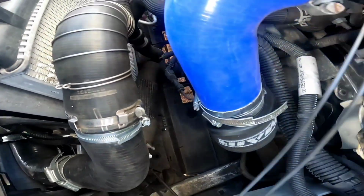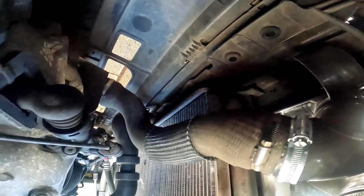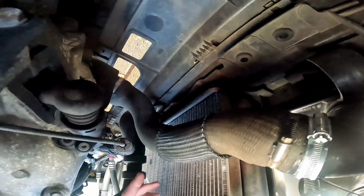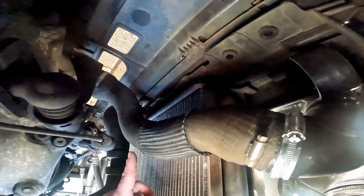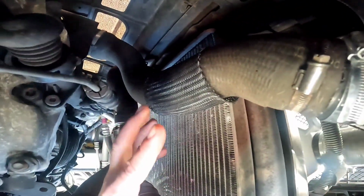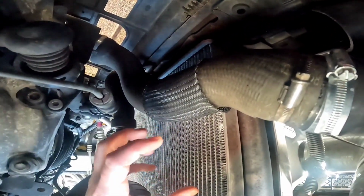Now, what you would also want to do, which I put in there as optional, as you can see, this pipe is under a bit of stretch. What you would ideally want to do in the real world to resolve this intercooler setup properly is to put a 90 bend here, a coupler, and then a 120 bend into here, and that would remove this stock pipe, allowing for better airflow, because it's definitely getting a bit nabbed up in the corners there. It's running a bit tight.